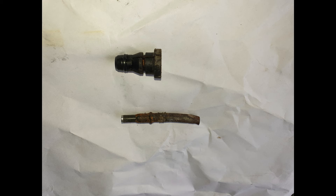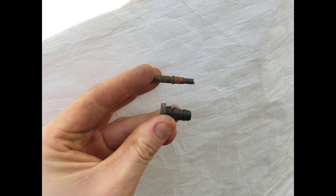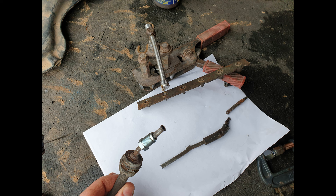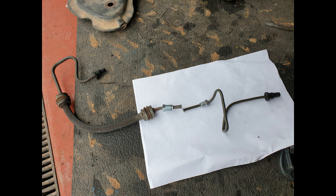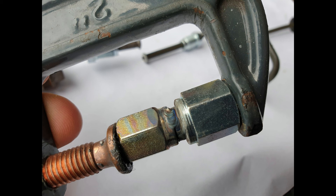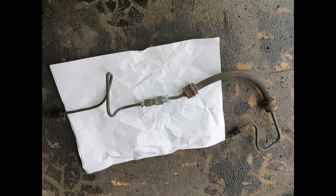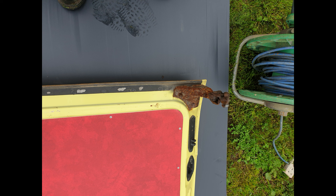When I was blasting the van I noticed that the clutch master cylinder pipe started leaking and made a mess all over the place. I couldn't source one of these pipes — I searched all over the web — so I had to make one. This is a quarter inch pipe reduced to three sixteenths, with a flared fitting. I got a fitting pipe with the same connector and made a female-to-female quarter-to-three-sixteenths adapter, TIG welded, because I could not source one anywhere on the internet. The pipe I'm using is from an MK2 Golf — a Fox or Sapphire, I think.